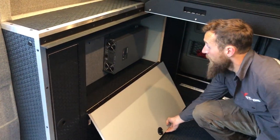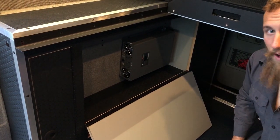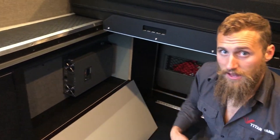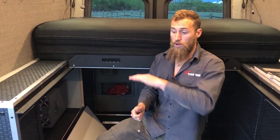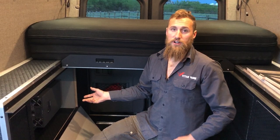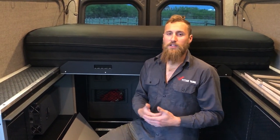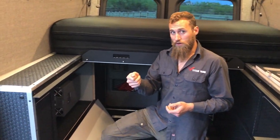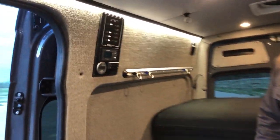Moving back, we have the inverter cabinet with additional storage. This is our Xantrex XC2000 — a great inverter/charger we're really happy with. When you plug in shore power, the inverter recognizes the incoming signal and uses a built-in transfer switch to transfer that power while simultaneously charging the battery. The inverter's primary function is to take DC current and convert it to 120-volt AC so you can run all your appliances — hair dryer, blender, toaster, microwave — anything you've ever plugged into a three-pronged household outlet.